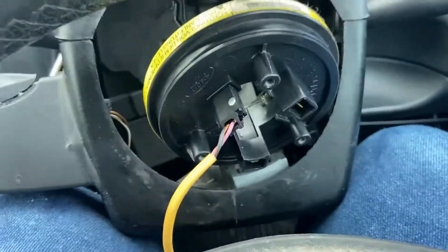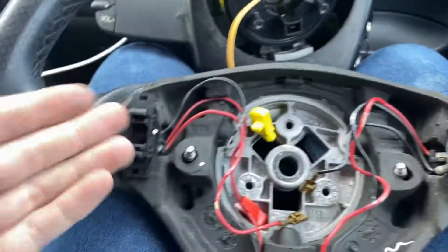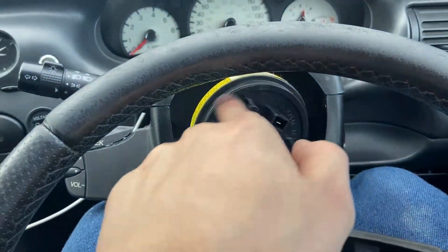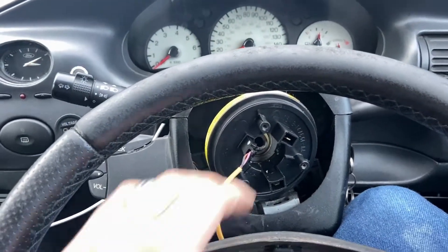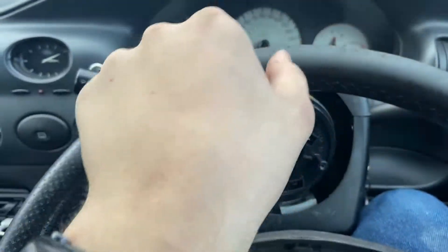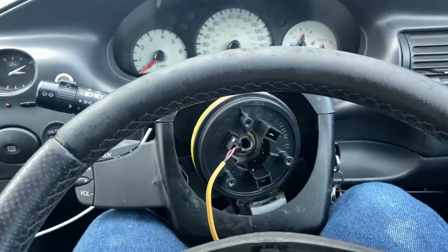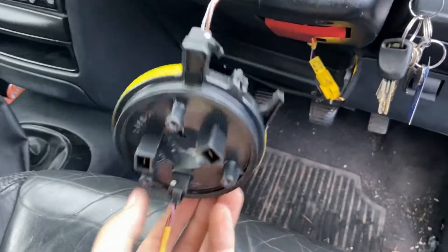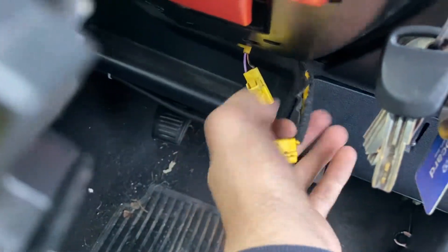You basically just need to pull the whole lot out really. That's the clock spring — squib, whatever you want to call it, airbag squib. It's basically a wire that goes inside and loops back and forwards repeatedly, and that allows your wheel to turn the full direction without any wires twisting up or getting tangled. That's what the squib does. The airbag squib itself doesn't unplug here like you'd think — it actually unplugs further back. If you put your hand up behind the steering cowling you'll find the plug — just unplug that and you should be able to remove the whole lot.